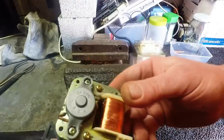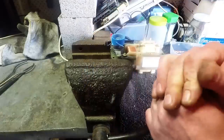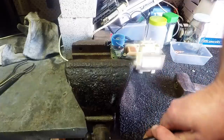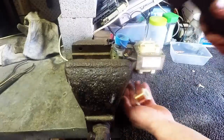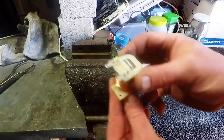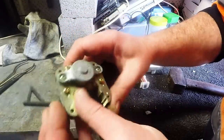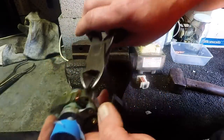The second one is the fan motor. I'll just knock this out in the vise - pop it in there nice and tight, and I just want to knock off this copper spool. We've removed the spool, and this part here - because it's thick steel - can actually go as high grade steel. Sometimes we can pick off a little bit of copper, but sometimes it's just too tight and you can't do it.